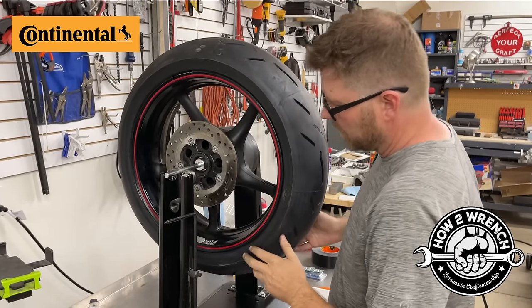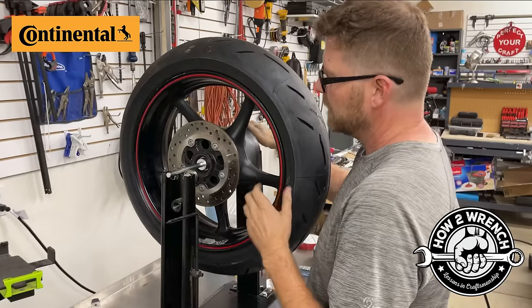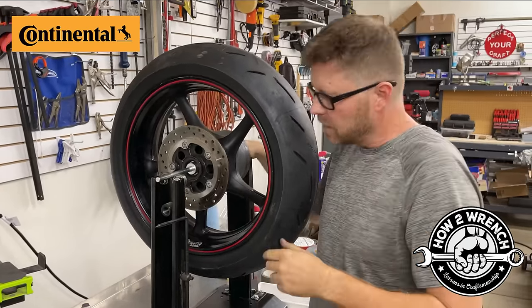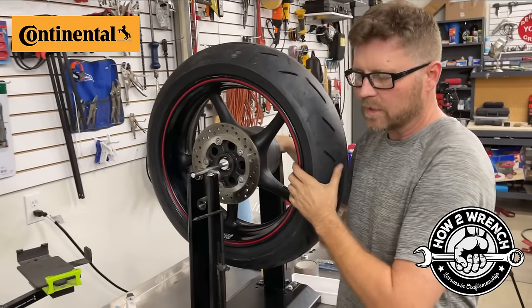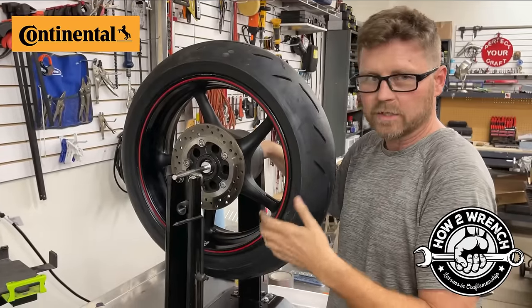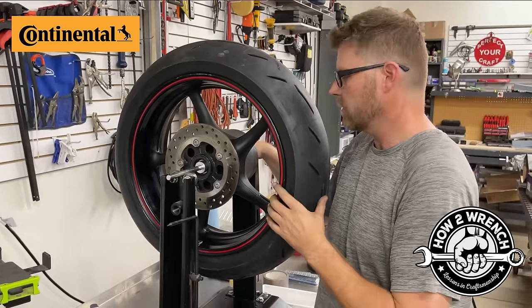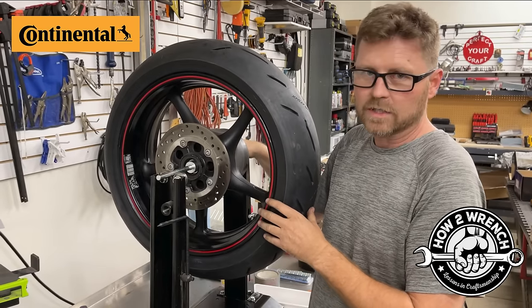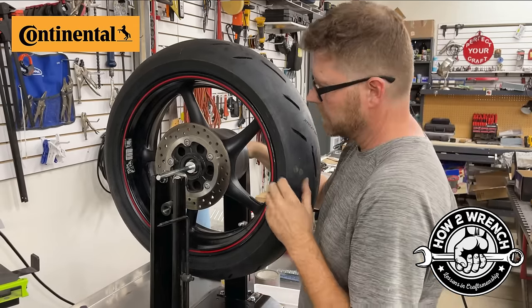So what we're gonna do, the way I break this up, and I could do this lightning fast, is, well, let me back up here a second. People say, oh, you need to have your wheels dynamically balanced with electronic balance or whatnot. I mean, this is the way they balance them at the racetrack. Everybody you see doing it at the track uses a gravity balancer. They wouldn't be racing 180, 190, 200 mile super bikes doing it this way if it just plain didn't work. So don't be afraid of these, just telling you.